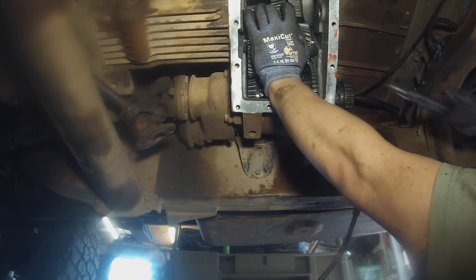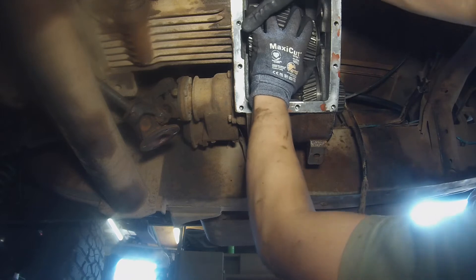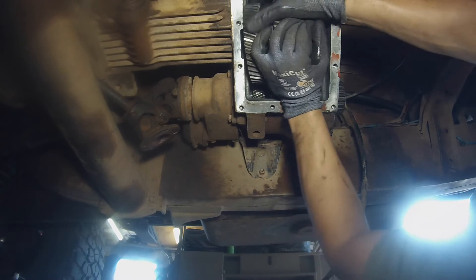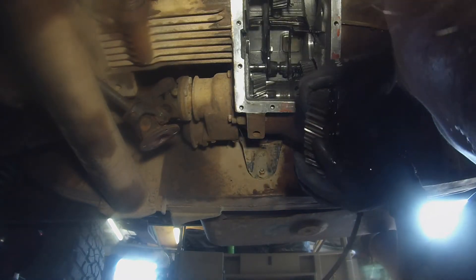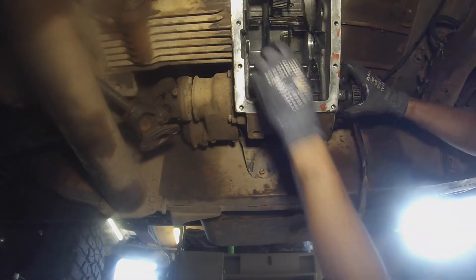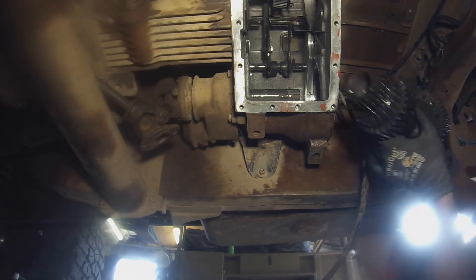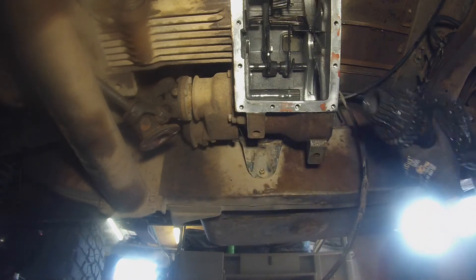In this case they were stuck, so we need to remove the intermediate shaft first. Once you can support the gears from underneath, pull the bolt out — a lot of jiggling may be required before you can free the assembly. It should slide out easily enough once you get it loose. At this point you want the center differential to be engaged so the dog clutch stays in position when we've slid the center differential out. The splines you can see there lock onto the front prop shaft output flange.